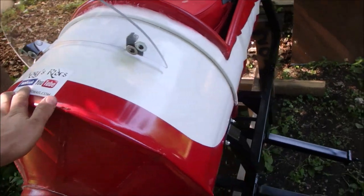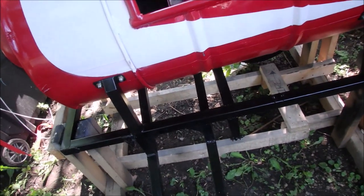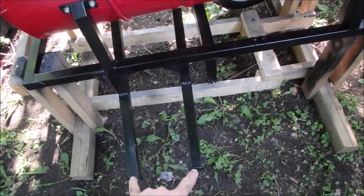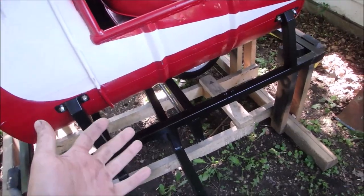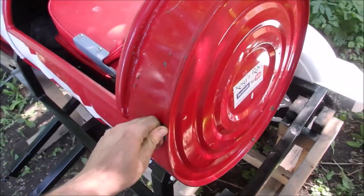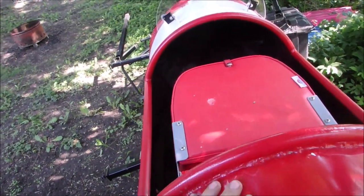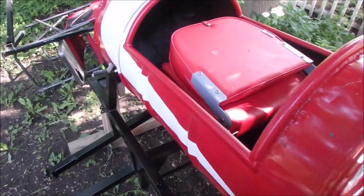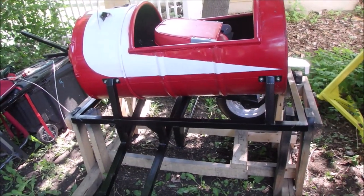That's really the only changes I've made. I'm going to do a little bit of alignment stuff. I also shortened the top links — that's for the alignment because I had them as short as they could go and they needed to go a little bit shorter. I was trying to push it out farther but I was out of adjustment, so I shortened those top links and painted those. Otherwise it's largely unchanged, just cosmetic stuff. I did think about trying to do four up on this bike — two kids in here and me and my wife on the bike. The interesting thing will be to see if the big bore kit has enough power with factory gearing to haul this thing around. Otherwise I'll put the 47 tooth rear sprocket back on. So let's hook it up and figure it out.